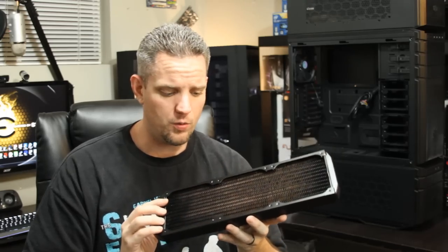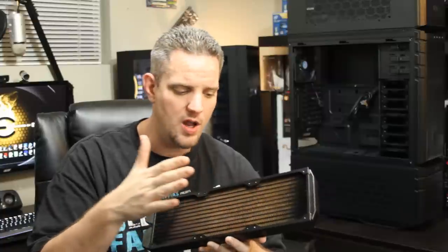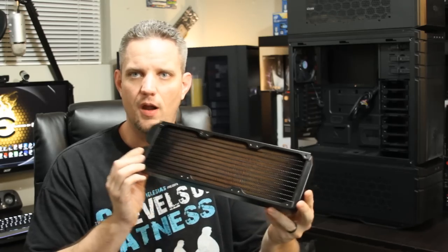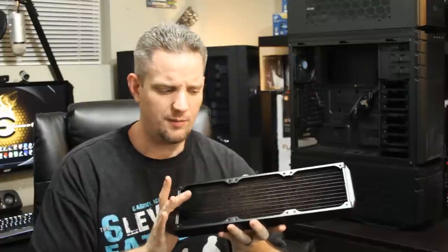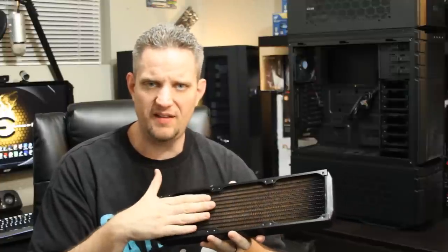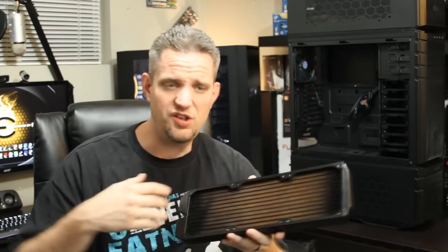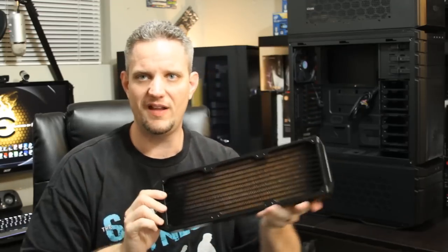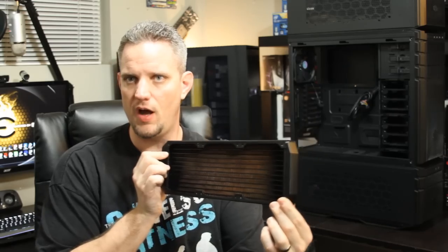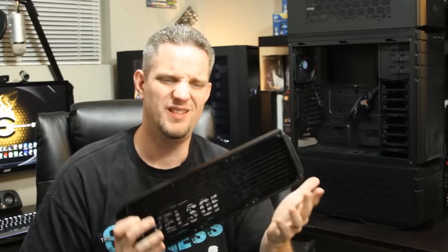Typically, brass copper means you have brass end tanks on the end of the core, with aluminum fins and a copper core. But radiators like this one from AlphaCool have all copper construction — copper rows and copper fins making up the core, and this is what's doing all the cooling. You can even see in the video it's kind of black when I go one way and copper when I go the other. AlphaCool's concept is that any paint applied to the fin only decreases its cooling efficiency, so they just do a quick dusting on the core.